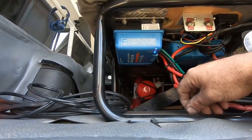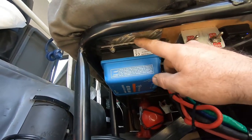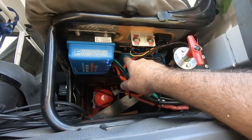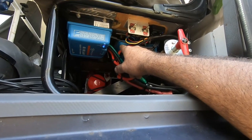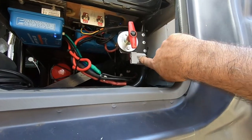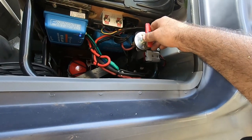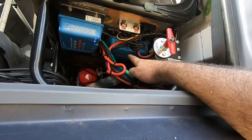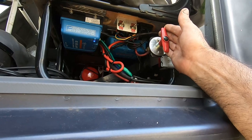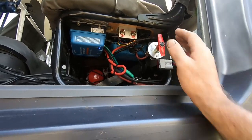Here I've got a couple of Victron chargers. This is a Victron 130 MPPT charge controller for the solar panel on the roof — I've set up a heat sink for them as they can run hot. This one back here is a DC-DC 24-to-12-volt charger that charges the batteries off the alternator. There's also an Anderson plug for photovoltaic input — solar power in for a mobile solar panel. And this isolator is for the DC-DC charger — I had some battery drainage issues and putting that isolator in fixed the problem.